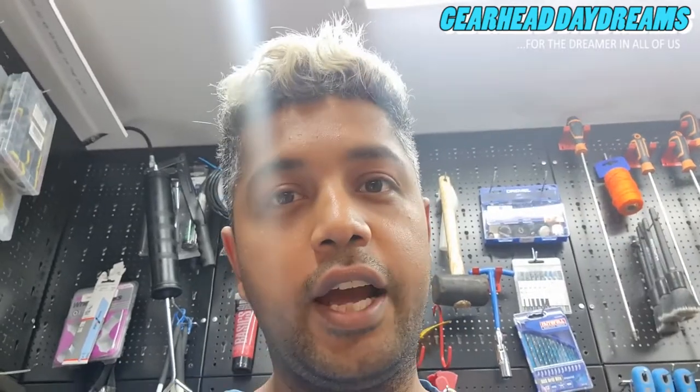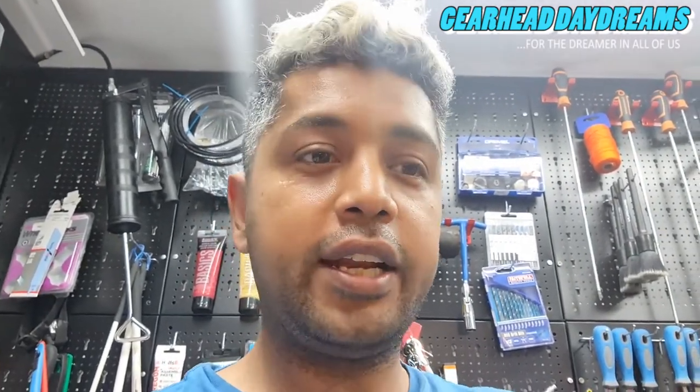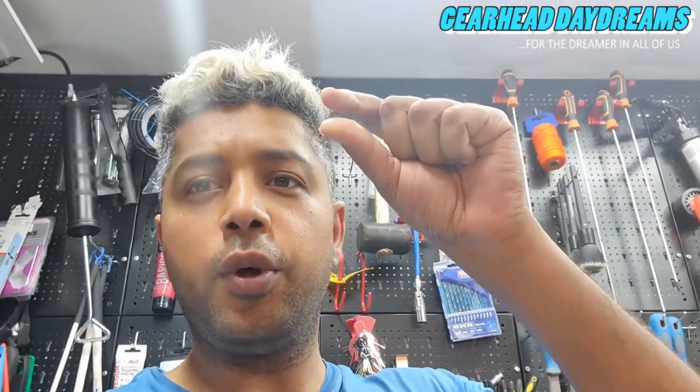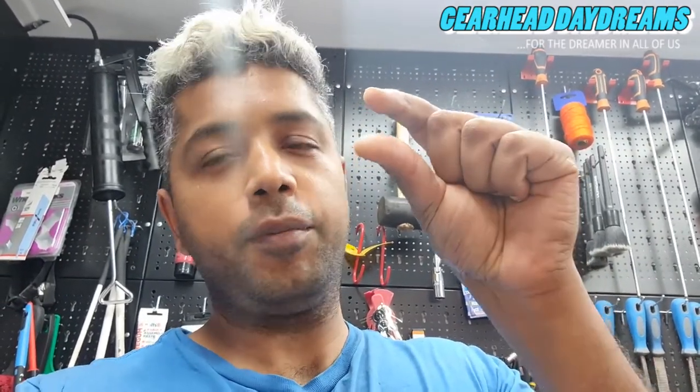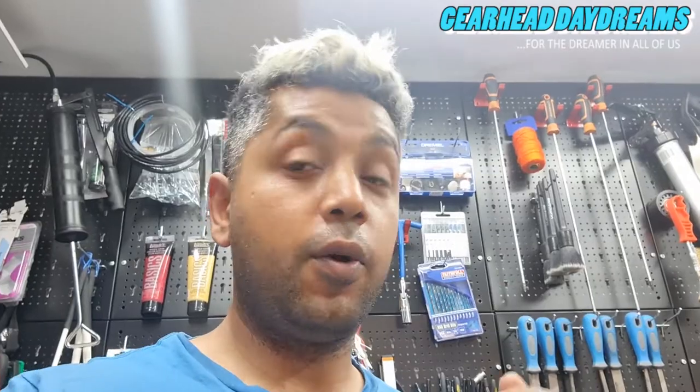I can explain more of that when the time comes. So to be able to do that with the wheels hanging, with the car up in the air, the wheels hanging down is no good. And if the car is on the ground, I can't get underneath it and do the tightening of the bolts. So what I need to do is get the car up and then build four little platforms or little stands, which I can put under all four wheels, because end links are on all four corners. And then when I lower the car, the wheels go on them, and those boxes take the load from the car. So the boxes are loaded, and even if they break, it's not the end of the world. But it's going to serve two purposes. One is added safety, and two is it adds more capability to do a lot of the stuff that I can do. I can tighten suspension components whilst they're loaded, which is big, really.